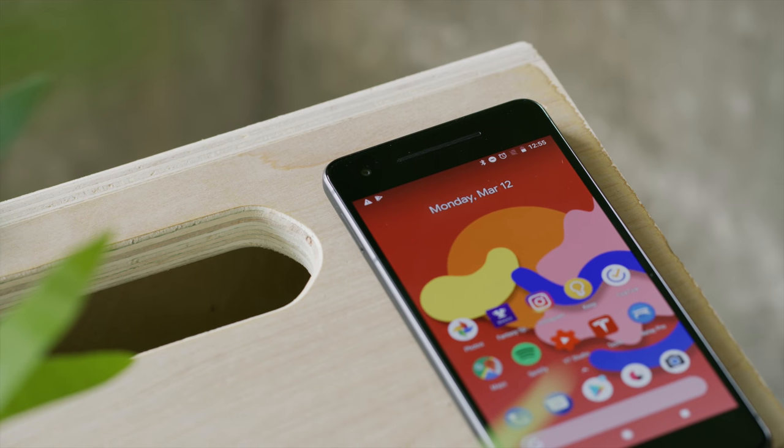If we really want to shrink the bezel to zero, we have to find a place to put all of those things. Starting with the microphones and light sensors — those are actually pretty small. You can put the microphones on the top or the bottom of the phone. The proximity sensor does have to be on the front so you can put it up to your face and make a call and it turns the screen off. But the ambient light sensor is so small it can go almost anywhere. So then there's the earpiece — to make phone calls, where do you put that?